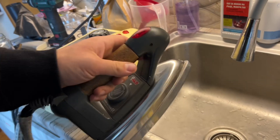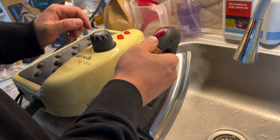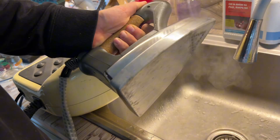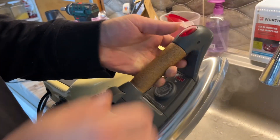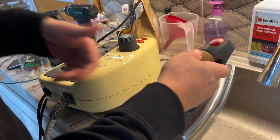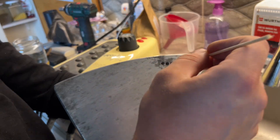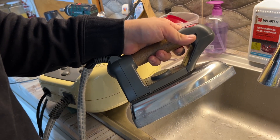What I did was pump the water about five times on the second tablet, then rinsed it. With clean water, I started pressing the button before it warms up so it just sputtered water from the outside. I was also pressing the button and tilting the iron to get water and steam, water and steam, sputtering through the holes. And also with a big barbecue pick, I cleared all the passages to make sure they're open for the steam.